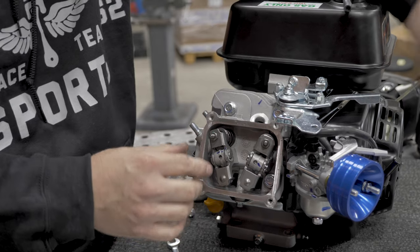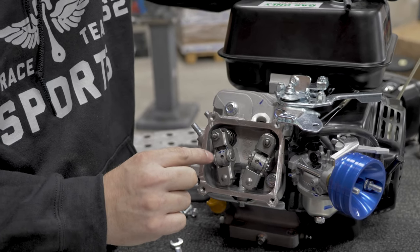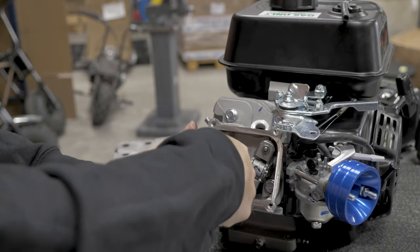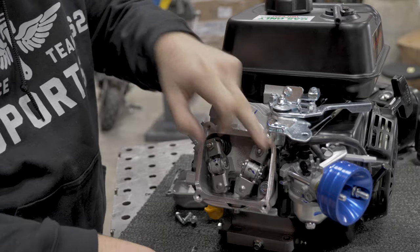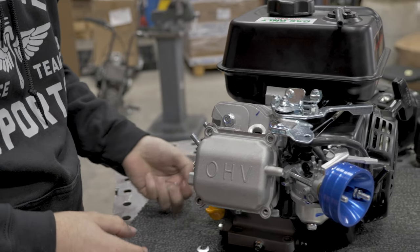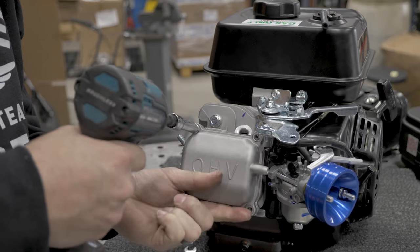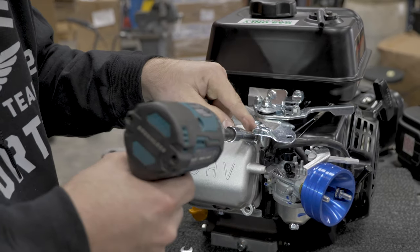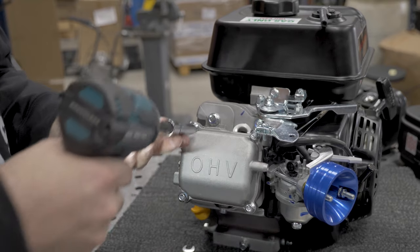I usually rotate over one good time and then watch for the exhaust stroke, intake stroke, then the exhaust just a little bit, and then watch for the piston to come up all the way to the top — that's when you make sure everything is set. Go down with your fingers and just spin the push rods; if they spin freely you know you set them right. You can set them anywhere from zero lash all the way to three thousandths. If you set them at three, as your engine heats up and warms up, if you have to restart it, it tends to have quite a bit of kickback as you pull the rope. At zero, when the engine warms up, they'll loosen up to about one and a half to two thousandths.